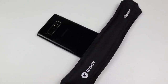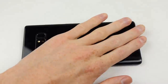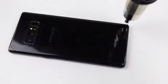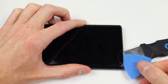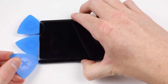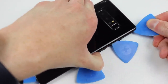To actually open the device, I'm going to need to soften the adhesive. I started with iFixit's iOpener tool and I recommend wearing safety goggles when taking the back off a Samsung because if the glass shatters, you have a risk of it going into your eyes — so always wear eye protection when working on glass phones. After having some difficulty, I pulled out my hot air station. I recommend using a suction cup whilst removing the back panel, as it reduces the risk of cracking it and makes it easier to lift. I need to heat around the edges and slowly work around with plastic picks to separate the back panel from the housing.